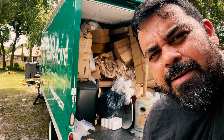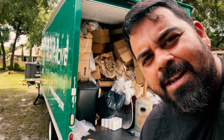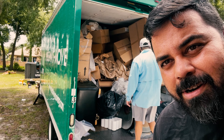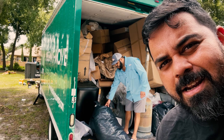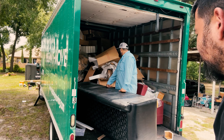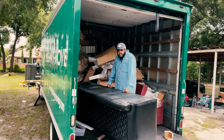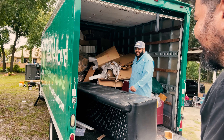We're gonna see. All right guys, got the truck at the house. First thing we did was clean out the throttle body — it was really dirty. Just to update you guys: so far we put a used DPF filter on it, we cleaned the throttle body out and put it back on. We were able to get it to crank and start, but it's not staying on. So we've got a friend of ours coming to plug into it with a computer to see what's going on.